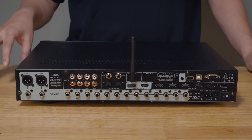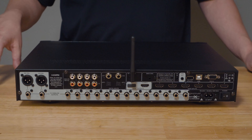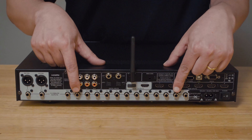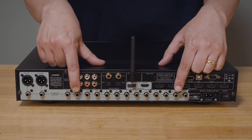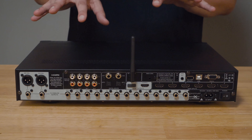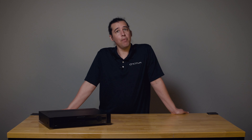That applies whether you have four reflective or four ceiling Atmos speakers. So: if only two, use the middle height connections; if you have four, use the front and rear height connections. If you have six Atmos channels, use all three options on each side for your heights, and you would not be able to use any width channels. One configuration that gets left out of these Basics units would be a 9.1.2 setup — nine bed surround channels with only two height channels — because those two height channels must connect to the middle height outputs which are also assignable as your widths. So you cannot use widths and only two height speakers at the same time, and you will not see a 9.1.2 layout listed in the speaker layout. Thanks for joining me today — I hope this video was helpful in configuring your speaker preset and layout with your Basics processor. Happy listening!